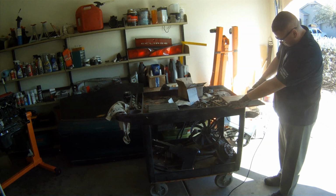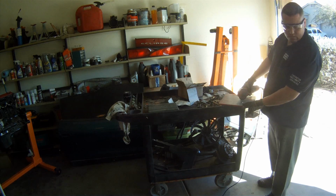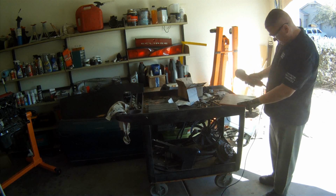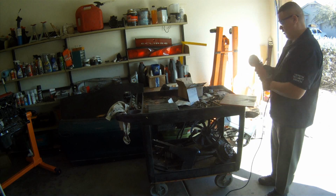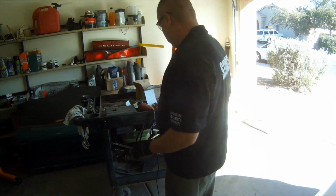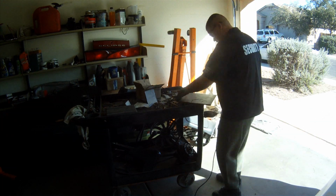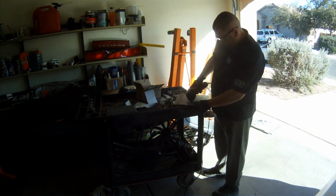Right now I'm cutting out the air conditioner bracket side. How thick is this? 3/8. Yeah, I'm using 3/8 steel for these two plates, and I'm also going to use the leftovers from this to make the welds from these plates to the stock Chevy motor mount brackets.